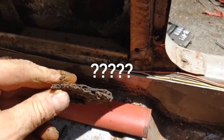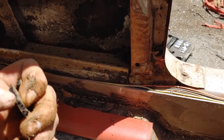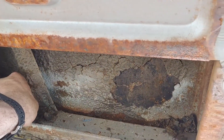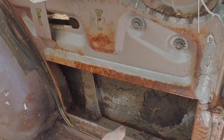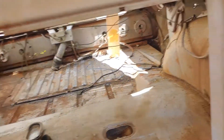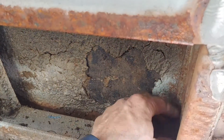Is that somebody shot this in? Is it sound deadener, insulation, leftover Ziebart for rust-proofing? They used to spray undercarriages but they never used to inject inside door panels like what I'm seeing here. Should I peel all this off or just leave it? I will rust-treat this car and paint the interior, but up here in the northeast anything that's a crevice or a hole is going to get sprayed with oil. I like Rust Check and Fluid Film — this car will get a good dousing of all that for sure, because otherwise it just would not survive.